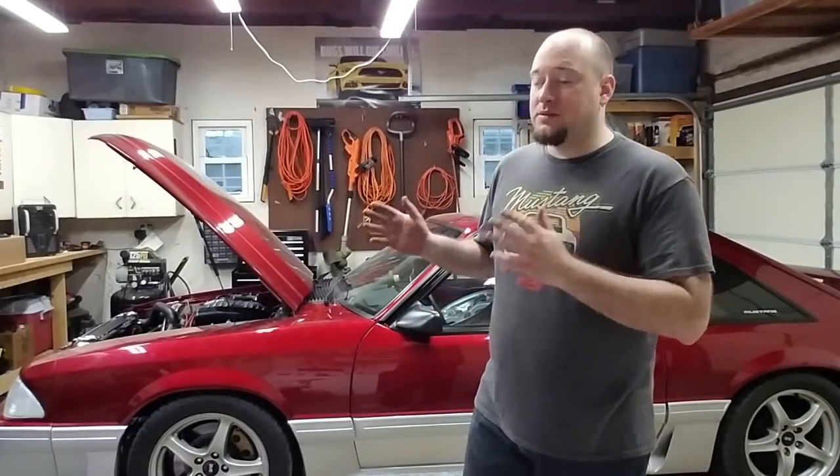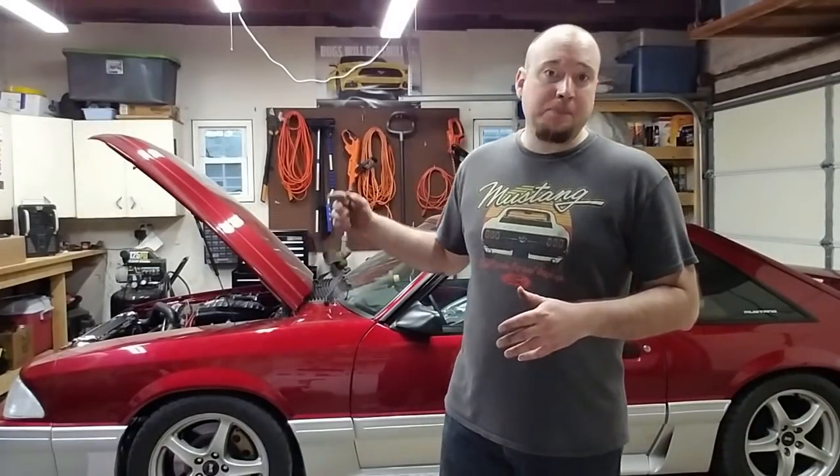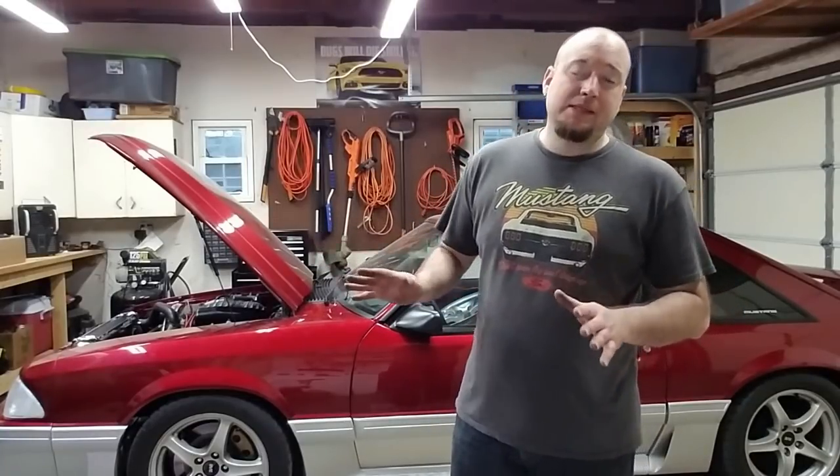I went ahead and re-RTV'd with copper RTV all over the hot side and also on the downpipe — scraped off all the old stuff and put a fresh bead of new RTV down. The purpose of this video is that I didn't know what to expect with this On3 system, but it's a turbo system — it's all pretty self-explanatory. You never know if you see oil anywhere what could be the issue. Lucky for me it was just the drain line. The way it was torn, it was torn towards the hot side, so if that had started spraying oil all over the headers it could cause a fire. Definitely keep an eye on that kind of stuff. I wrapped up the drain line with heat tape and I'll probably go ahead and replace that drain line anyway since I had to cut about an inch off.